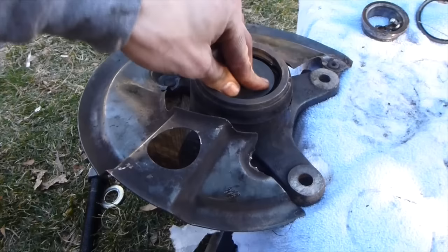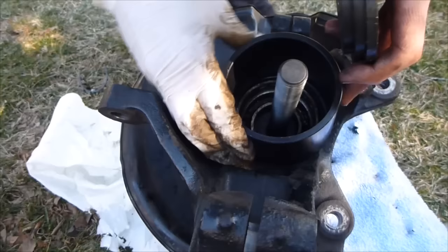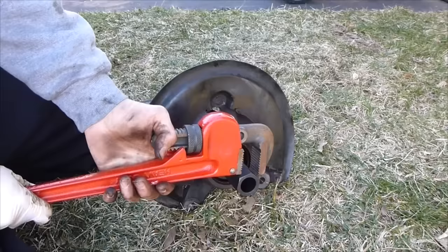You can see where the bearing is. Find the right size bearing press tool, put it in, drop the bolt in, and find the right size bottom piece which fits on the outside of the bearing. Place the plate on top, get your washer, screw it down, get your large socket, and tighten it down.